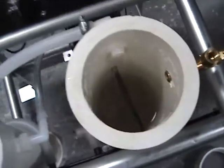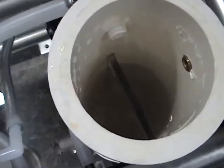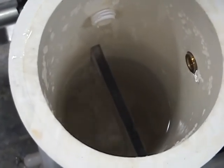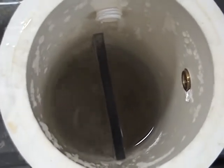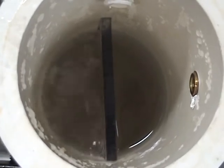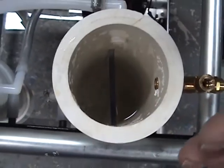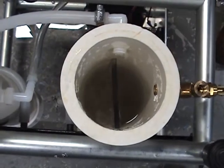I'm going to turn this on and power it up so you can see how this keeps the water separated in the tank, so that you're not sucking bubbles back down into your HHO cell. It works really well. You turn the plastic piece inside so it faces the back wall where the cell mounts, and it keeps the clamp from crushing the PVC when you tighten it.